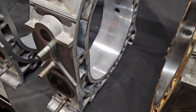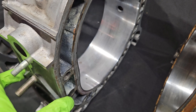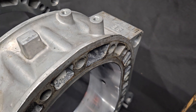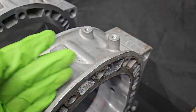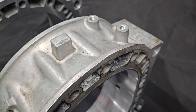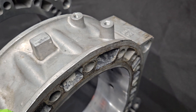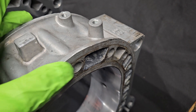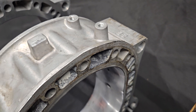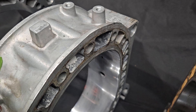If you're seeing discoloration or carbon buildup in those areas, that could all be signs of extreme heat. At that point you're going to want to spec the housing out per the factory manuals and factory specs. Any shrinkage or variation in the rotor housing in total that's over three thousandths of an inch — meaning variations bigger than 1.5 thousandths on each side in the same area, or 0.0015 inches per side — can lead to water seal failure, because the rotor housing creates a metal-to-metal seal against the cast iron plate. A lot of times those cast iron plates are not perfectly flat or completely void of imperfection. So when using used rotor housings against a used side plate, you're opening up the opportunity for a greater chance of water seal failure.